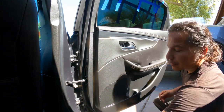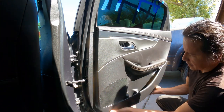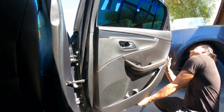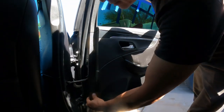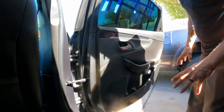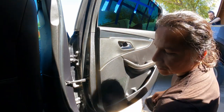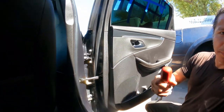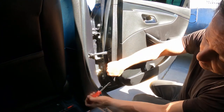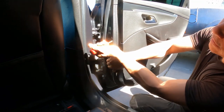We're going to remove this one too. These are three the same. So we only have to remove one, two, three bolts, disconnecting the connector, and we're going to use one of these. You can start right here in this corner because this door panel is really into it, especially when it's new. Those clips are going to keep this — already breaking loose here. You just do this and it's going to start popping.